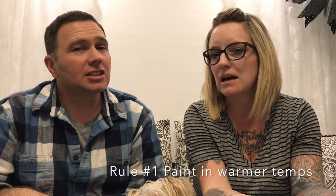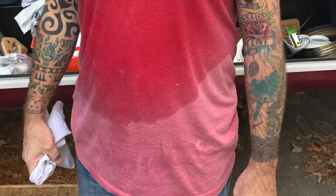We had to buy hand rollers and sand the whole RV again once it dried. Learn from our lesson: do it when it's at least 60 degrees outside. Spring is ideal — summer is going to be too hot to wear that Tyvek suit while spraying oil-based primer. Early fall before it gets too cold also works. That's our biggest painting tip: do it when it's warmer, not cooler. And surface prep, surface prep, surface prep — to make it last. Otherwise you're doing it all for nothing. You can scratch our walls and cabinets and that paint isn't going anywhere.